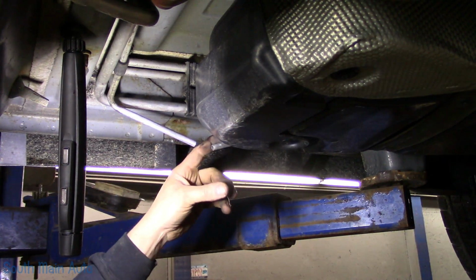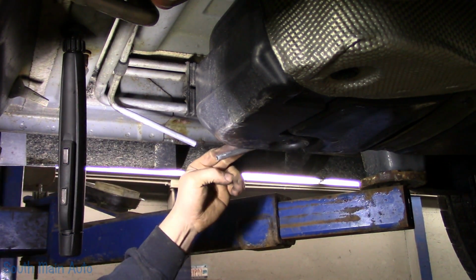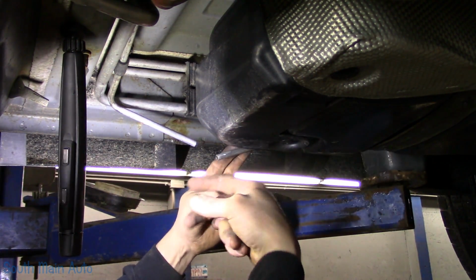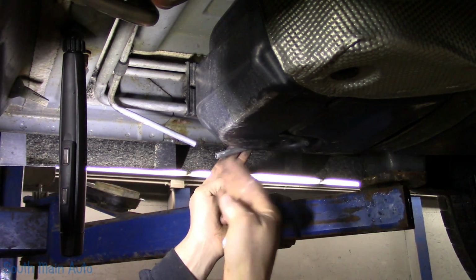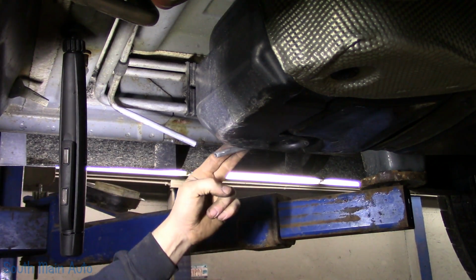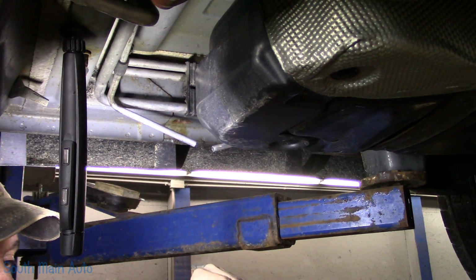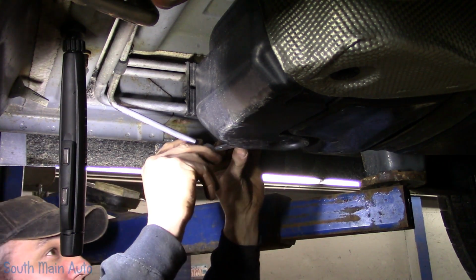So the other thing you could do, because you're kind of pointing down, try to keep them pointing down while you're working on them. So gravity, it's the law. It'll help you out. Or you could take your little blow nozzle and give it a toot in this direction, and use the Venturi effect to create a low pressure in here, high pressure out here. Suck out any loose debris and send them over there. Of course, if you get your blow nozzle going the wrong way, you just blow all the stuff up in there.